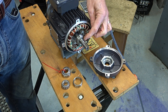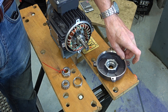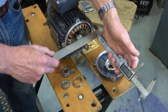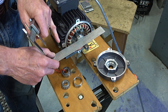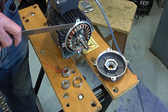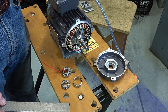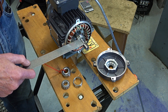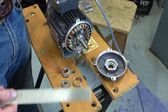I want to check the clearance between this face, the bearing and the bottom of this bearing boss here. I've used the calipers to measure that distance - it's 46 near enough. This is 28.5 across this rule, so I can easily work out the distance between that face of the bearing and this. I've worked out that the clearance is about 1.75 millimetres. That shows I really need to move these bearings in by 0.8 of a mil each to maintain the right clearance on the end. It was just obvious but I wanted to double check it.